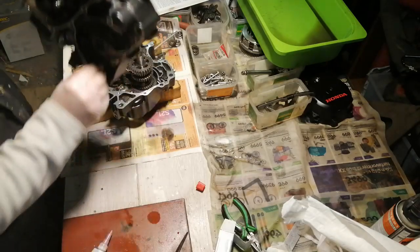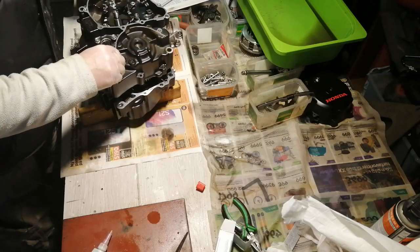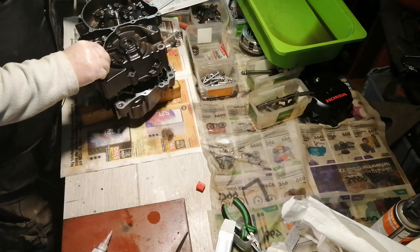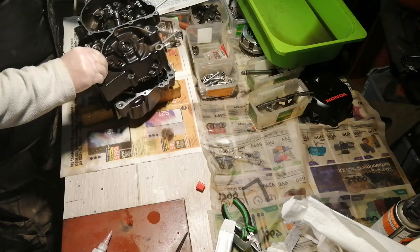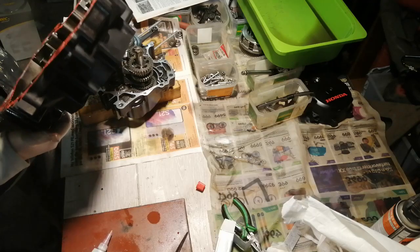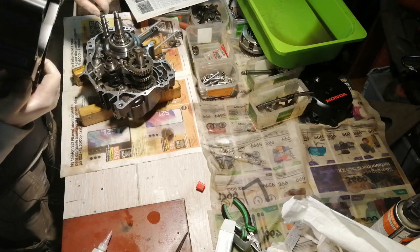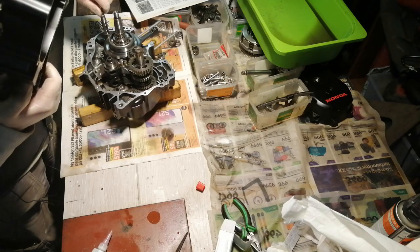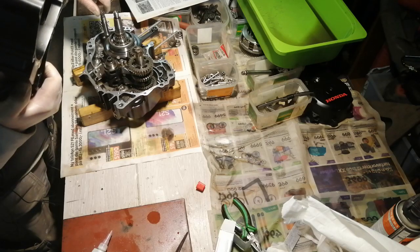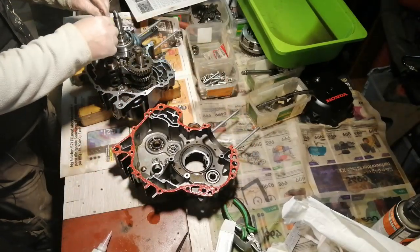Then it's just to pick it up and without touching the silicone edge, carefully position it over the shafts. This was when I realized I had the balancer shaft in the wrong way round. I can remember the puzzlement. Ironically, I had tried to put the balancer shaft in the other way to start with and thought it was wrong. This is why it's important to take videos and photographs and have the book — because you will do stuff like this.